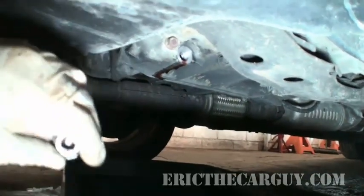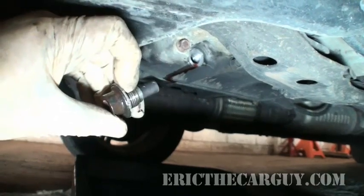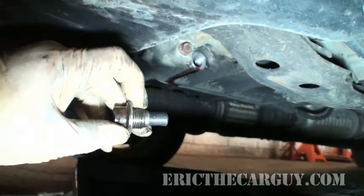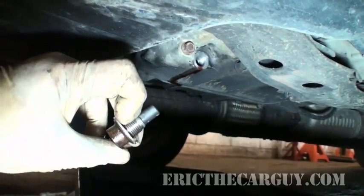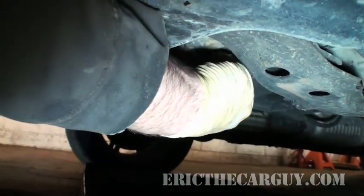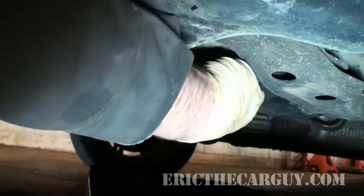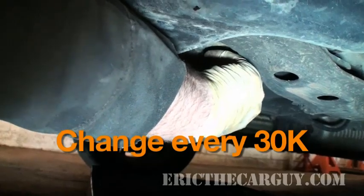Now it's pretty much down to dripping. You really should install a new crush washer on the drain plug, especially if it's mushroomed out — they're available at the auto parts store. You don't need to tighten it so much that you deform the gasket. You can reuse the gaskets many times since you're not changing transmission fluid as often as engine oil. Recommended service interval is every 30,000 miles.